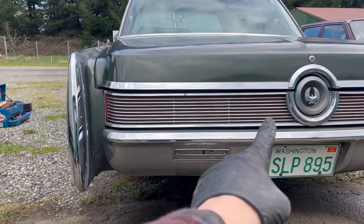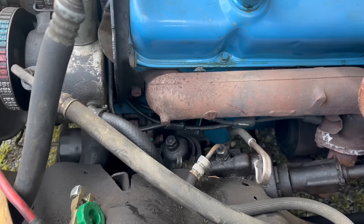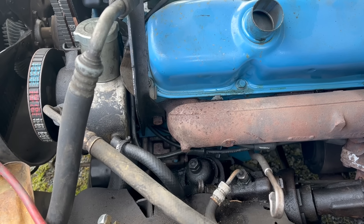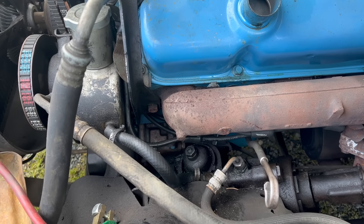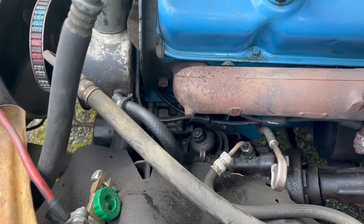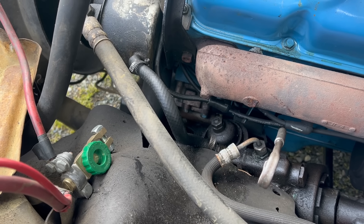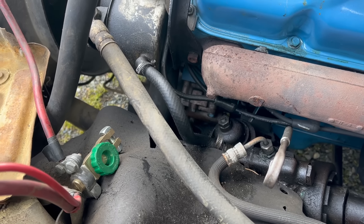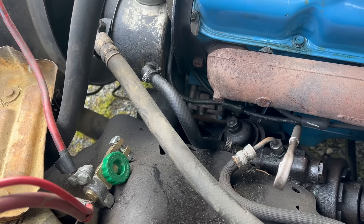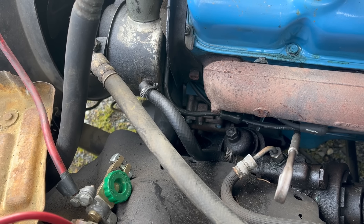Look at the brake lights hidden in that fancy chrome thing. Now, I do have one question. If this engine was just rebuilt and everything's all blue, why isn't the oil pump? That appears to have been installed recently — relatively recently. And it was still bare metal, which is now rusted a bit. But the bolts holding it on are blue, which means there was a different pump on the engine when it was finished. Why would they have changed the oil pump? Why was there an extra oil pump gasket in the glove box?